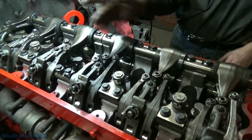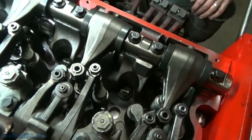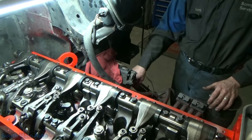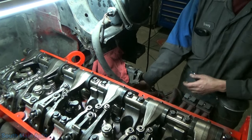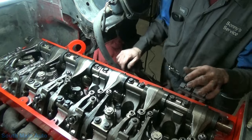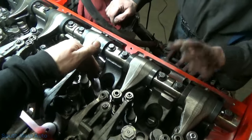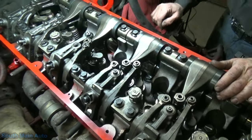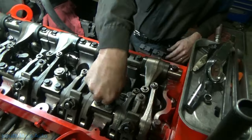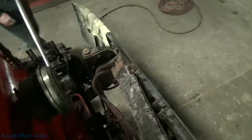These injectors are completely mechanical — controlled on this side for timing and fuel metering is done on this side with the fuel metering belt. Cummins website shows an awesome fuel schematic of this motor. There are no wires on the injectors — they're mechanically plunged but electronically metered and timed. It's all voodoo magic. Alright, one and five done — we're going to bar to three.